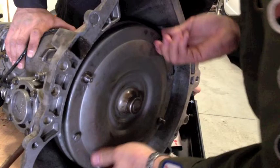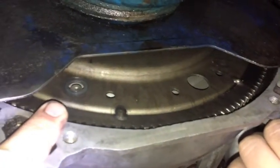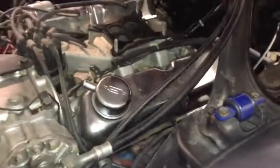That hole is where the bolts go — and those are actually drain plugs. The second click is what confirms it. It's very important to make sure those two little knobs you saw on the torque converter video — those are drains. This flex plate is specifically designed for that torque converter with two holes on both sides — that's where the drain plugs should be fitting. Right now we're backing the transmission out a little more so we can do a quarter turn and line the drain plugs up with those holes. Nick is tightening up the torque converter in the correct position.